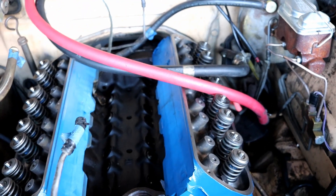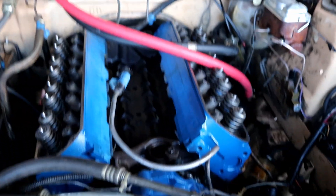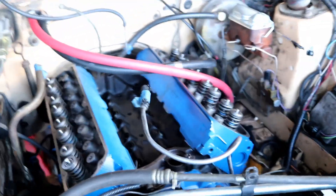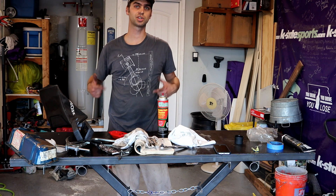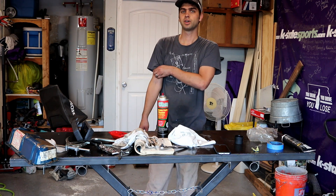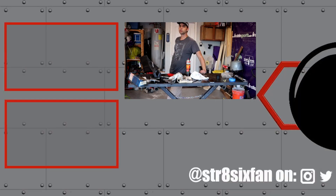That's kind of unsatisfactory. My torque wrench wasn't giving me the best feel, so I did the torque pattern 50, 60, 70 on that one, but I worry I over-torqued some and maybe under-torqued some — it was acting funky, the click type. So I just did 50 and 60 on this one. I'm going to see if I can borrow a friend's better torque wrench, check that side, and finish it off at 70. Otherwise, like, comment, share, subscribe. If you want to support the channel, consider buying a t-shirt from my Spreadshirt store — link in the description below. Go check out one of these two videos to get caught up on the GT40P swap. Until next time, peace out.